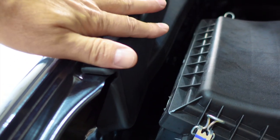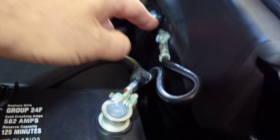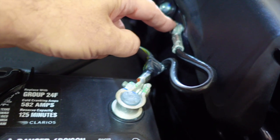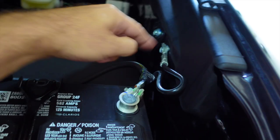So you can see this is very easy to take off. It just pushes forward. There is a little push pin right up here that you take off. That's pretty simple. That's it. On the driver's side, same thing. You're going to put your hood bracket right up here in this first bolt, so you don't have to remove both bolts and screw up your hood alignment. Down here is where the other little nub is going to go for the other end of the strut. It actually goes right here and takes the place of the little bolt, if you will, that holds on your ground. So it screws in right here. That's easy. You don't need to remove the little panel on this side to do that, because obviously you have access. So let me go ahead, get the camera set up on a tripod, and I'll show you how easy this is to do.